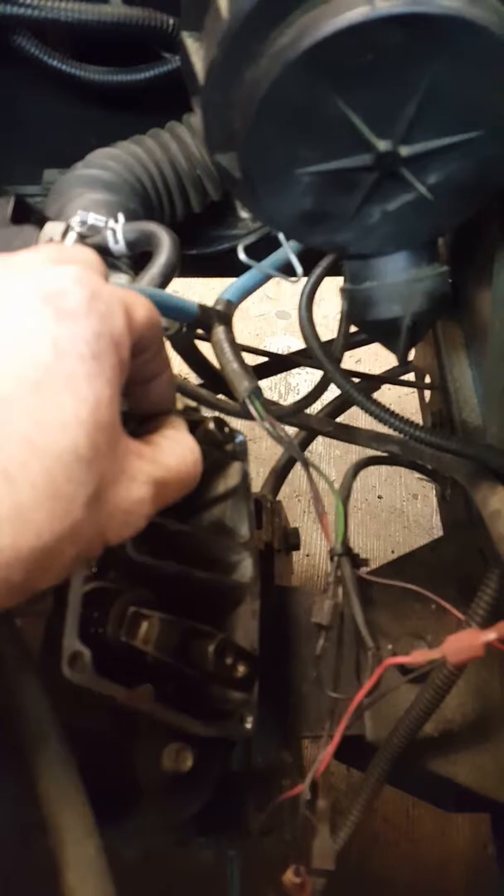What you want to do is take your valve cover off. The valve cover has four 10-millimeter bolts. Pull your valve cover off and you'll see your exhaust valve and your intake valve. The intake should be six thousandths clearance. Just pull up on it — you should use a feeler gauge, but I just pull up with my finger and feel a little bit of play.